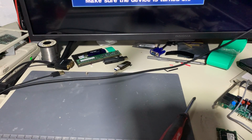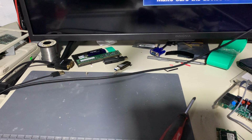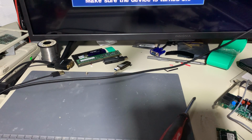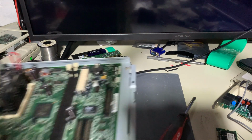And I'm looking here, I'm going to take this off camera to see a little bit better in my light. I don't see any that are obviously spilling their guts right now, but that doesn't mean that they're not. And let's see, is there any branding on these? There is absolutely no branding. LXB, SMS capacitors, a lot of SMS. So I think it's a cheaper capacitor variety. Really hoping that this system was workable.